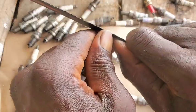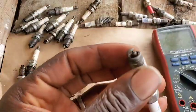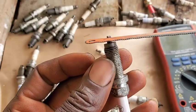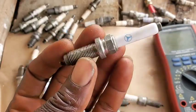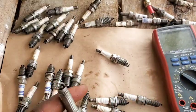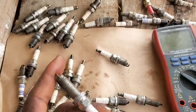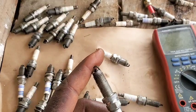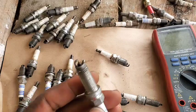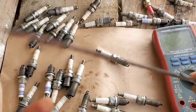I'm going to use this tool to offset it a little bit and give it some clearance. You should use a spark plug gauge based on the car's specific model. Whenever a spark plug has this kind of issue, the car is going to be misfiring on that particular cylinder. Most often it won't misfire at idle, but when you rev up the car, that's when the misfire appears.